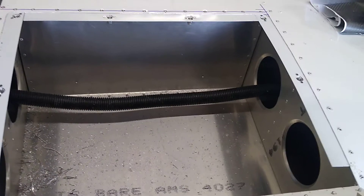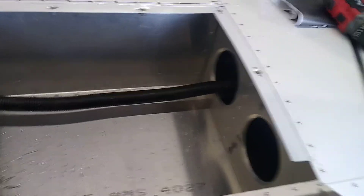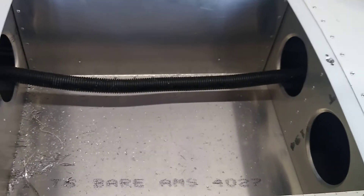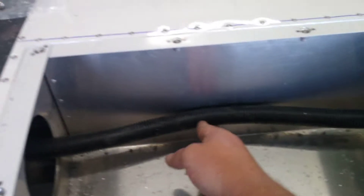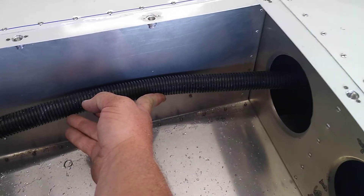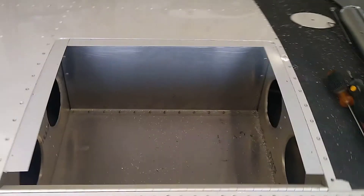She opens up. This side - I ran a new conduit and laid it across the ribs. I put it in conduit and laid it across the ribs rather than opening the whole wing up to put it in grommets. I installed a heated pitot tube for my Garmin. I'm just going to tuck this out of the way, attach it to the wall, and carpet over it.